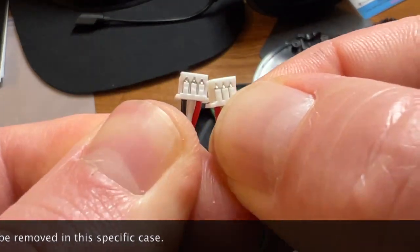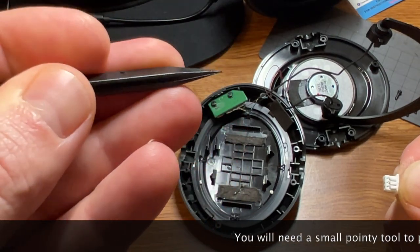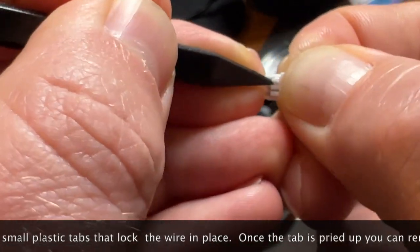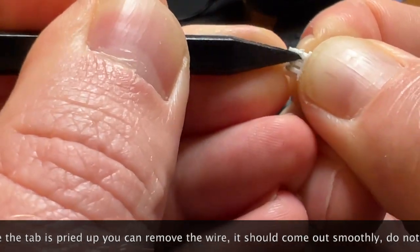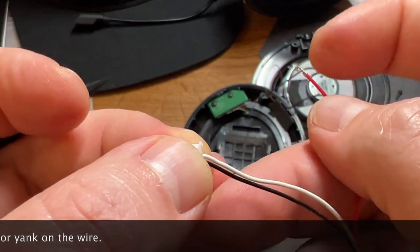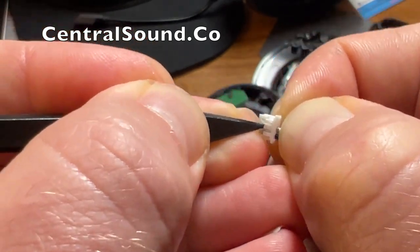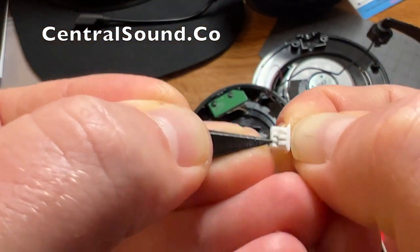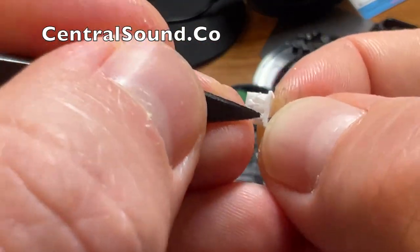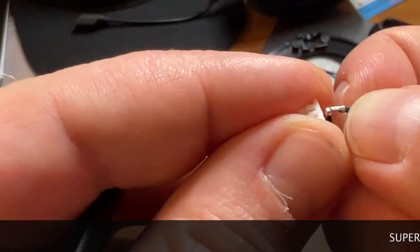I'm going to use a small pointy plastic tool — insert it under those tabs and pry them upward just a little bit. Once those tabs are pulled up, you should be able to remove the wire. These tabs are the locking mechanisms that lock the wire in the connector. There is a small connector piece at the end of the wires — you definitely don't want to ruin that because you're going to need it. Just continue to work at it, pull up each individual tab, and the wires will slide out fairly simply. If they don't come out easily, pull the tab up a little more to get it loose.